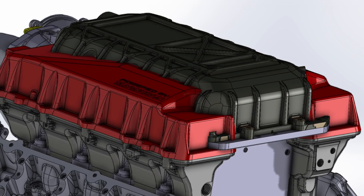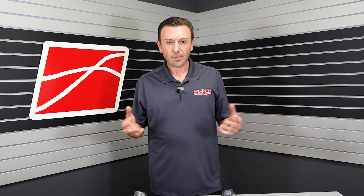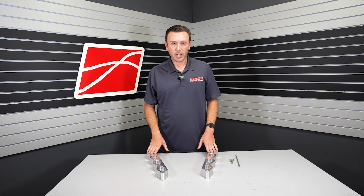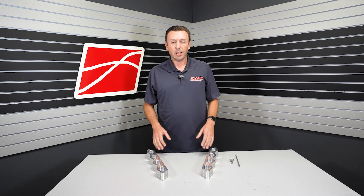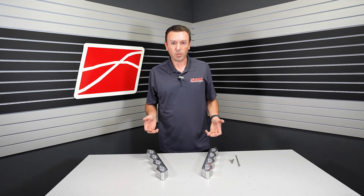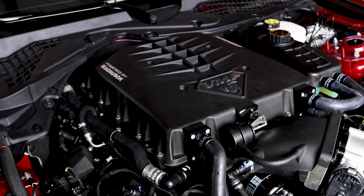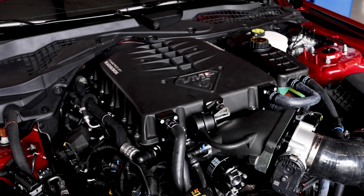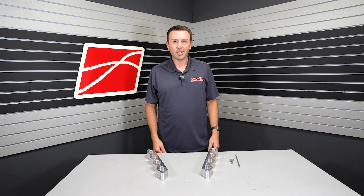So if you do this swap, you've got to do drop motor mounts, you've got to do a cowl hood — you just got to mess around with stuff, or you've got to have an engine bay where it doesn't matter, like an F-150, or you swap the Gen 3 engine into something else altogether. Just an FYI: we are making these parts available now on the VMP Performance website, so watch out for the hood clearance issue. If you don't want to go to the trouble of piecing together your own supercharger system, at VMP we offer the Odin and Loki supercharger systems for the Gen 3 Mustang and F-150. Make sure you like, subscribe, and share, and I'll see you next time.